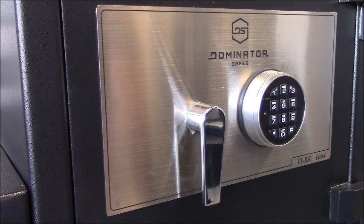There's also the 3035 keypad, again not quite as common with this particular lock, and it's intended to be used with either the square bolt or the swing bolt lock body configurations, and the same for the 3750 series keypad. It's able to be configured with the square bolt or swing bolt operations. Like I said, this particular one is the 3000 series keypad, but these instructions and features will apply to all the different variations, as the functions are actually programmed in the firmware of the lock body inside the safe.